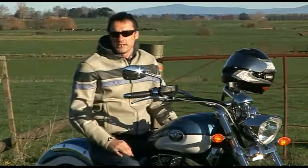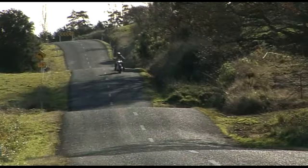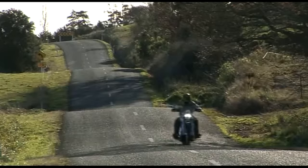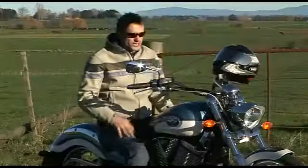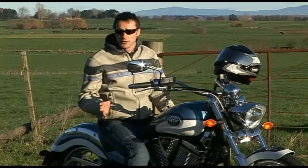Like any big bore V-twin, it's all about the torque, and the Victory has got heaps of it. Don't need to rev this thing off to the red line, you just short shift it and stay in the meat of that torque curve, and it's a real pleasure. But if you want to rev it out, the Victory will happily come to the party and give you plenty of over rev. It's 288 kgs dry, which will bring it to somewhere around 300 wet, fully fueled.